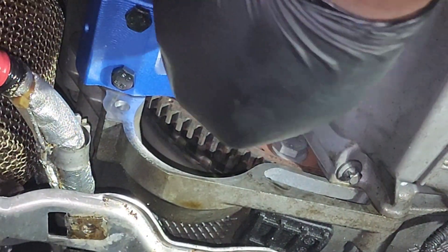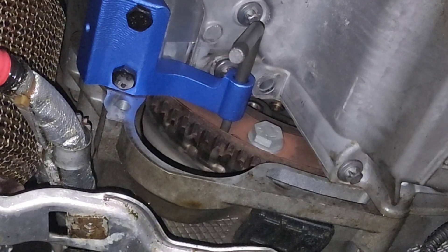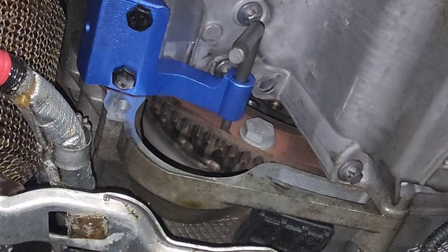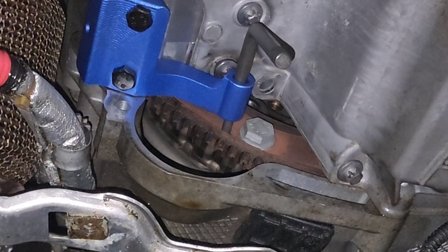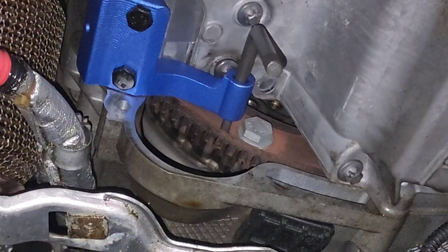So that's why you can only turn it clockwise. I turned it very slowly to avoid any possible chance of passing the hole, inch by inch, bit by bit, kept double-checking where the flywheel position was until I actually got it lined up with the locking pin. Once I got it lined up, I put the pin in place and double-checked it with a slight twist just to make sure that it was actually locked.